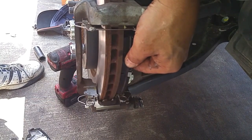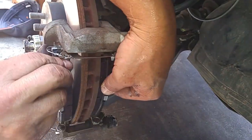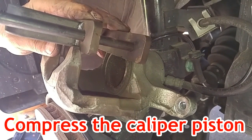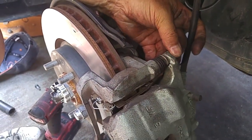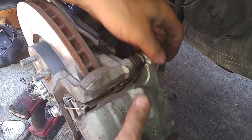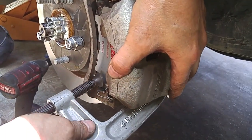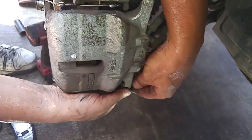This spring popped out of here. I'm going to hold these pads down and use my C-clamp to prevent the pads from popping off. As long as this ear of the caliper is up against the pad, the pads won't pop off. Now I'll just slowly take this bracket off the C-clamp, and now I can install a lower mounting bolt.